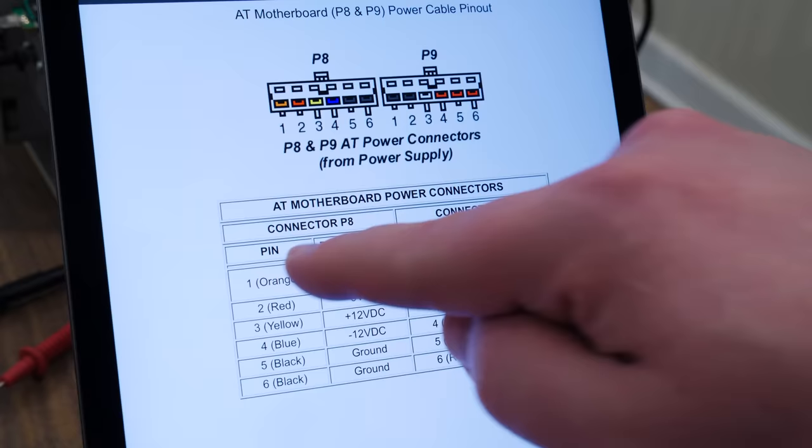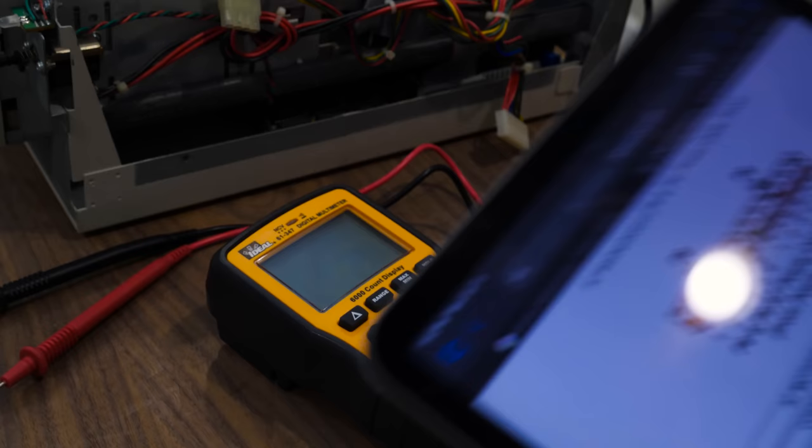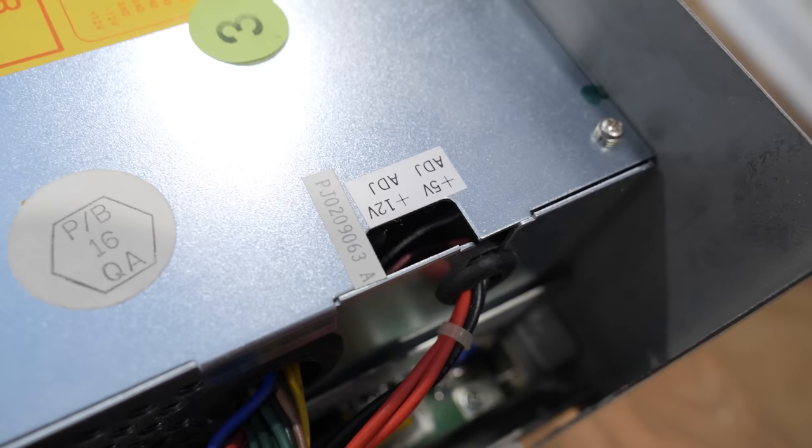And just as a reference, here's your normal unmodified AT power supply. That's just missing the pins 1 and 2 there. So it was a plus and minus 5 volt that are just not there, and you have just the 1 minus 5 over there, and that's pretty much it. So it's just a couple of missing pins. It's fine otherwise, I guess. Oh, hey, and there's also 2 potentiometers in there for adjusting the plus 5 and 12 volt rails.